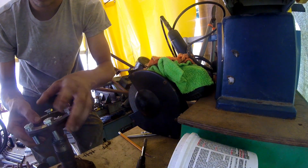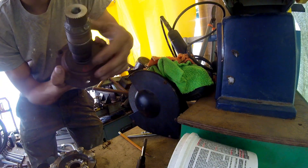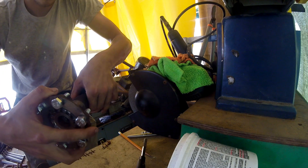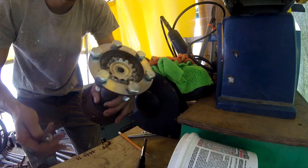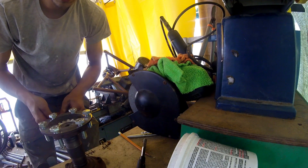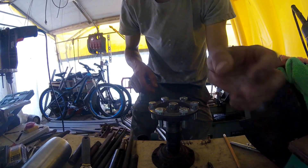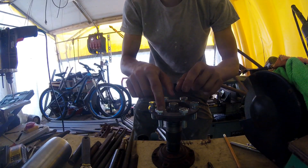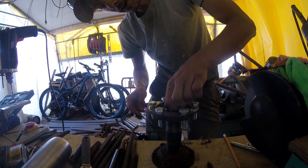So we should be safe to go on both these parts. I'm not worried about the splines stripping at all now. And then I laid a TIG weld in there, so that's good and strong. So we're not going to send this out for heat treating — we're going to bolt it in and it's going to be ready to go. Now I'm going to do the same thing to the other side, and this will definitely be the end of this rear end video until I get the hubs back with their holes drilled. Probably next week sometime.